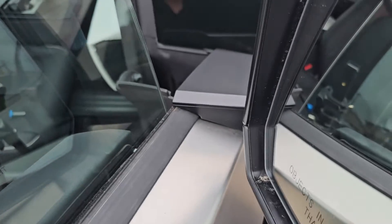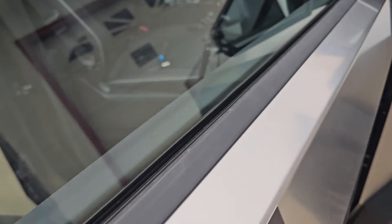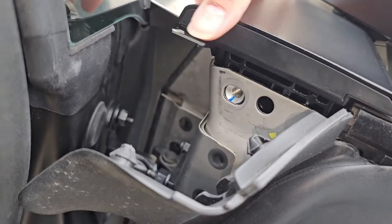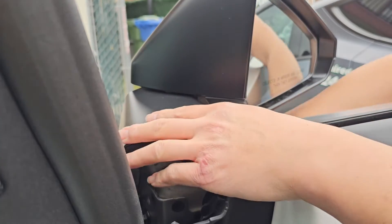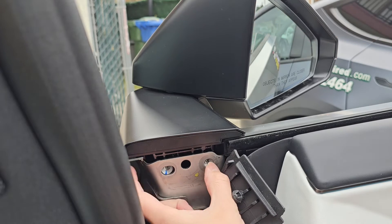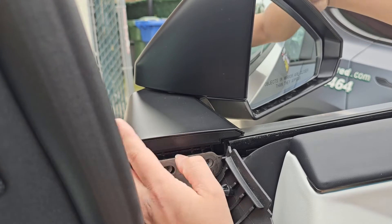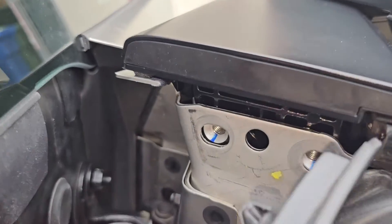You can see it's folded right now. Let me roll down the window so it's easier to work on. Now we're just gonna pull this up — I'm gonna need two hands for this. You want to get one hand underneath on this side and from this side as well, and it kind of rocks up. There is a clip down here, so you actually want to pinch that in, and when you pinch that in you can see it goes up. There's a little clip there — you want to push that inwards to unclip it from there. There's also a clip on the other side; wiggle it and it came out.